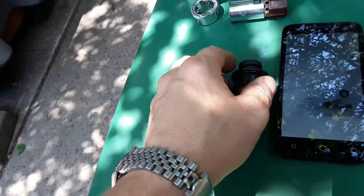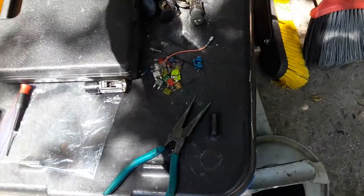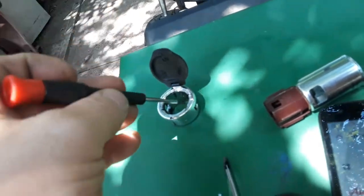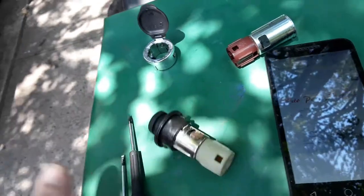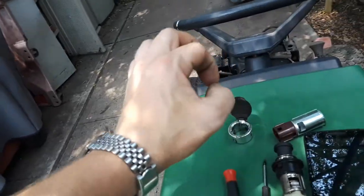Here's how it was in the dash — I already took it out. There are plenty of videos on how to take it out; it's simple enough. If you buy the Dorman version, it comes with a T-handle tool to help push it out. If not, you can take a couple of flathead screwdrivers, stick them into the slots, and pop it out — the whole thing including the bezel piece pops out. Then there's just one more tab you pop and the plug comes out.